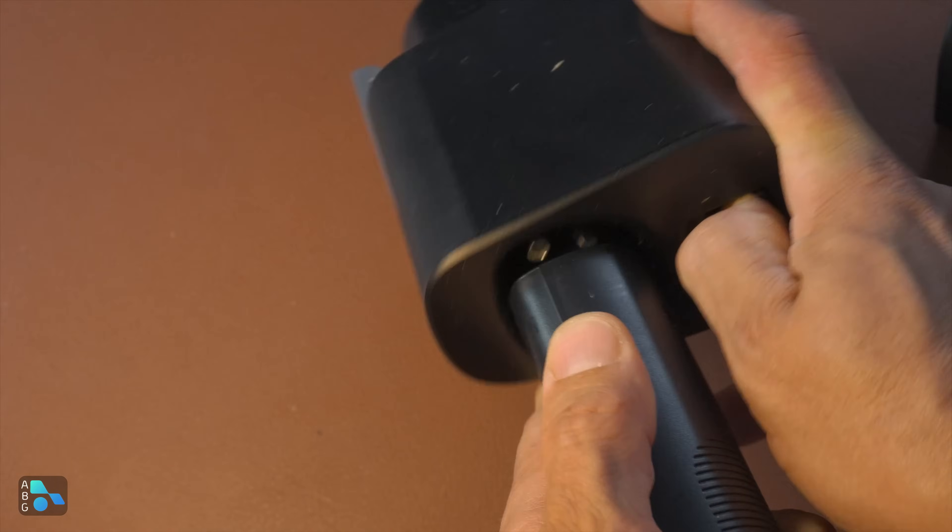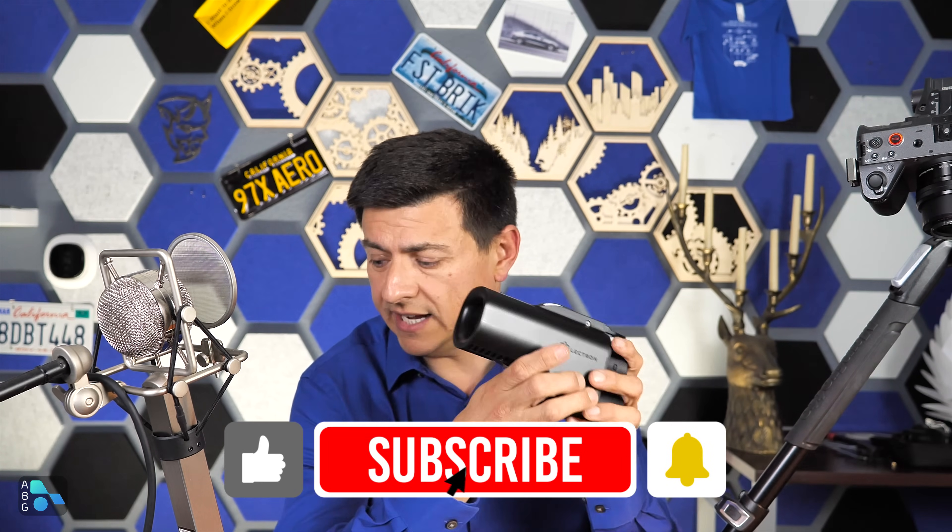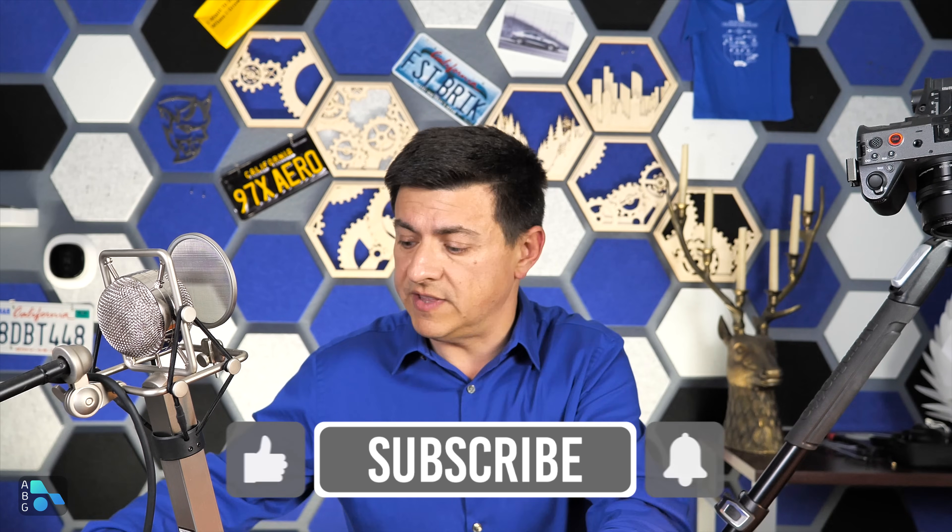And that is because, contrary to popular belief and a lot of things I've seen out there, these connectors are not smart connectors. The vehicle has no idea what you have plugged into it, and neither does the charging station. The charging station and the vehicle obviously know about one another, but they don't know which charge adapter is sitting in between. All three of these adapters are essentially the same as far as the electronics go. Now, importantly, there is some difference when it comes to the build quality of these adapters, and there's another video on the channel if you want to know in greater detail about why the Electron adapter has some definite advantages over the Tesla one.